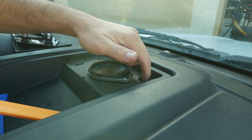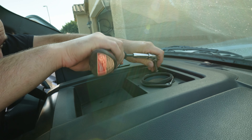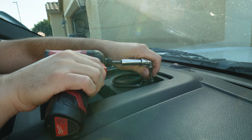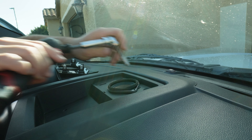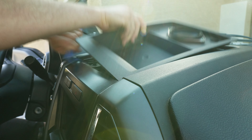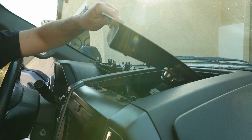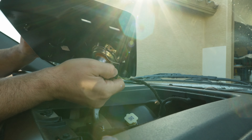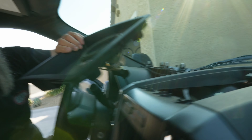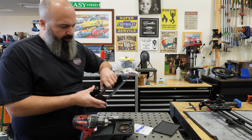There are four clips and then an alignment tab on the front — this guy is really solidly in there. Up front I believe these are going to be seven millimeters; I'm just using a little right-angle adapter here to pop those up. Now we've got three more clips up front to pop up. With that up, we get back here, hit the push tab, disconnect the speaker, and we'll take this inside to get it mounted.